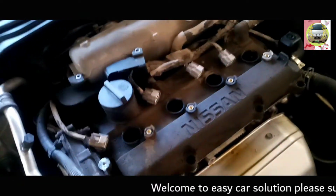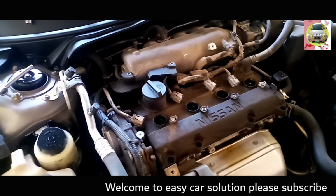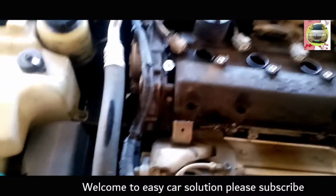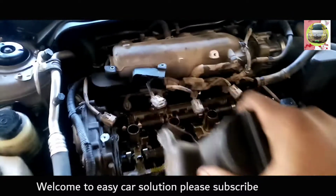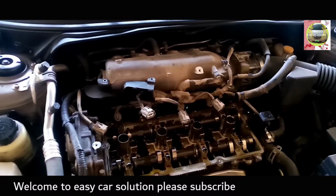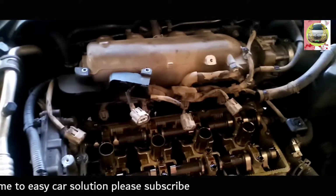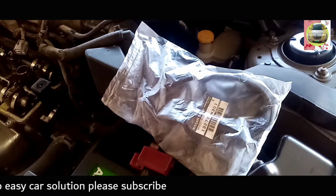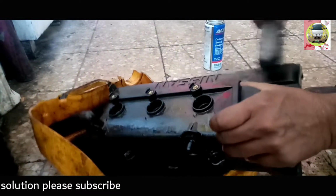Before I loosen this bolt to open, now I open it. It's a 10 millimeter bolt. Okay, now I take out this cover, this tappet cover. Okay, I remove this tappet cover. This is the new seal, tappet cover seal. I clean this tappet cover first.